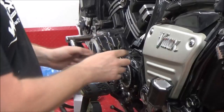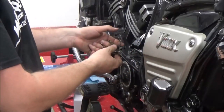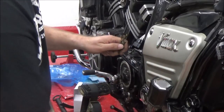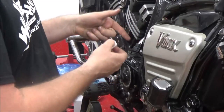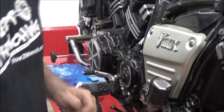This little tip will save you some problems. We need really good integrity between these three connectors — this AC output here puts out a lot of heat to the regulator rectifier. The problem with just putting all three together in a new connector is you could have a really good connection on one but maybe not on all three, giving you a false indication that everything is fine.